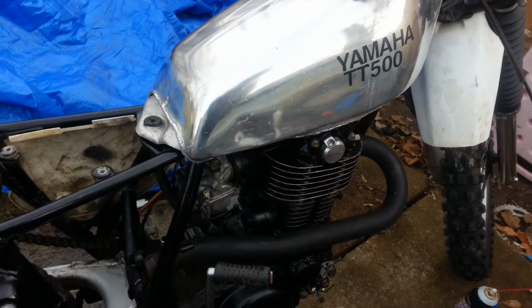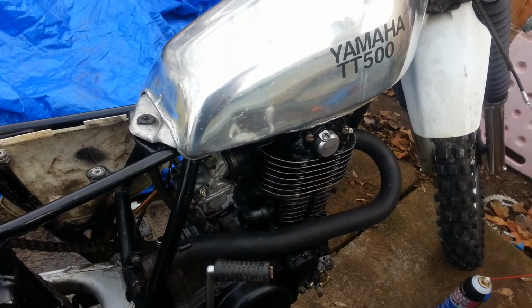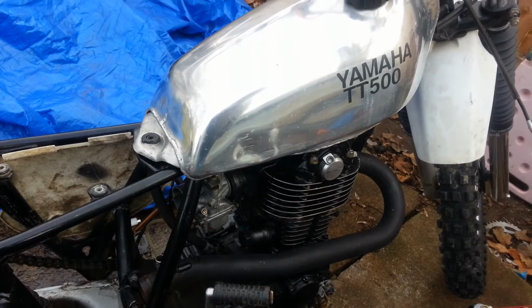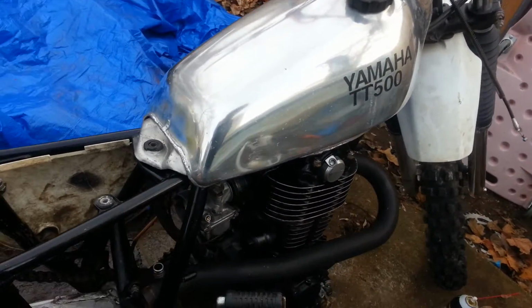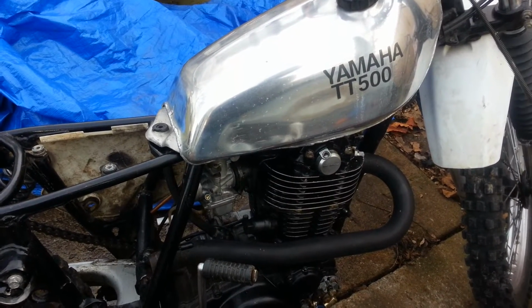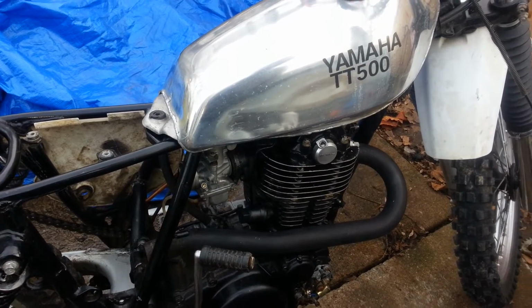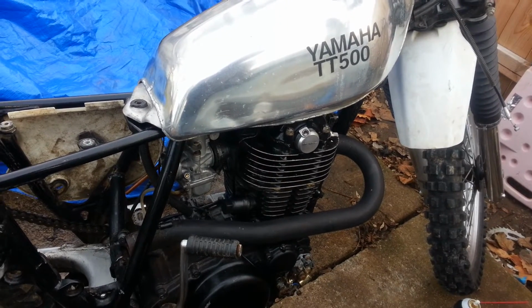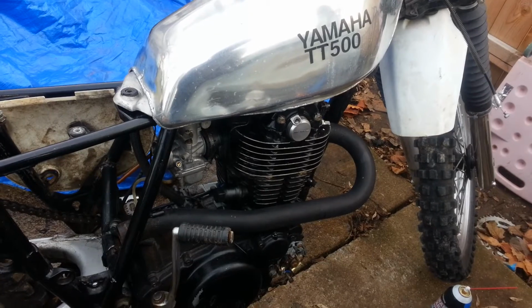The deal was, this is not a stock cam. It's some vintage Megacycles cam, man, with a crazy, weird lift and duration. Some sort of old racing cam. I don't know what grind it is, but it's crazy. I had to retard the cam timing to get it to run. I don't know how well it's going to run, but I know it starts up and it revs up.